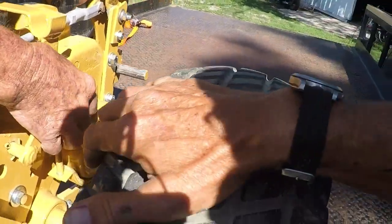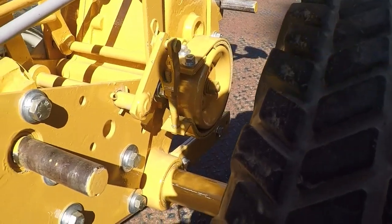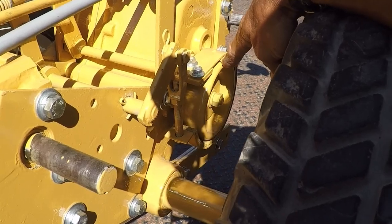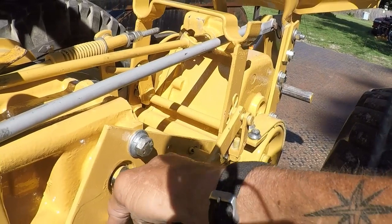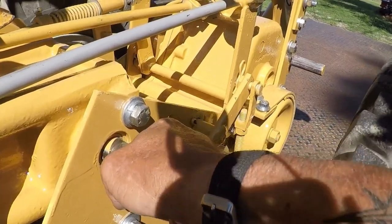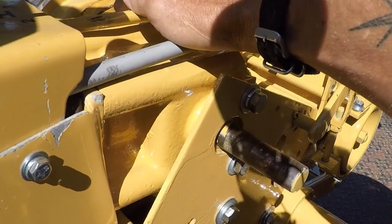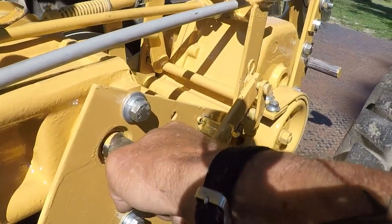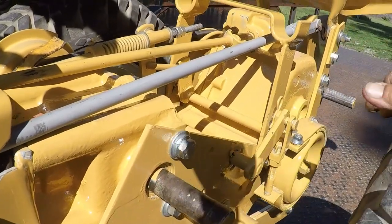That pulley there was new. And there was some seals here that were awful shiny. That's a different hub than usually, it's a cast iron hub, so that makes sense. Boy, that's a good tight bevel gearbox too. Wow. Now when you put this back together, did you put the same shims in that were in it? Okay. Yeah. Because there is zero side play. There should be just a hair. But it should be okay.